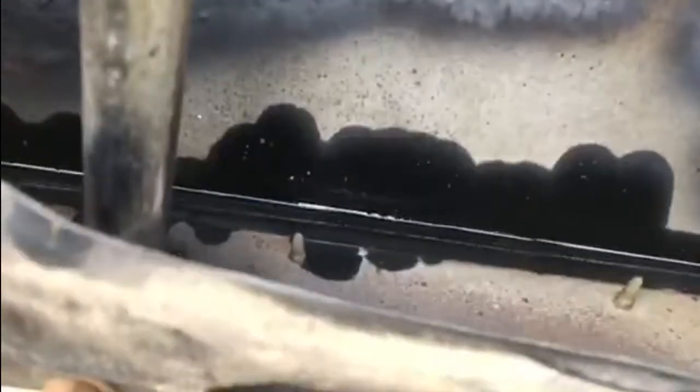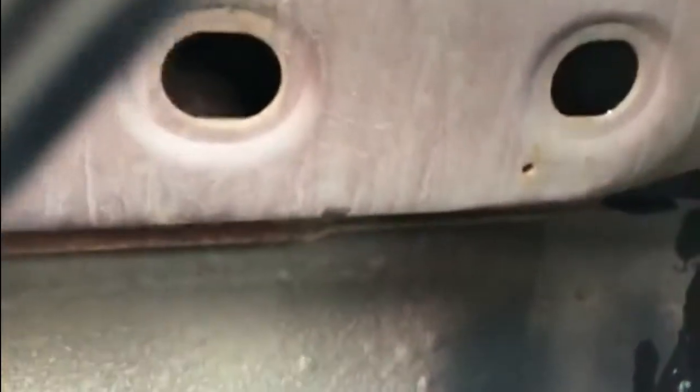The other thing, whilst the door was apart, that I thought would be worth looking at is the bottom of the door. Inside, where that's all wet there, I've just squirted some oil in there — some old oil I had lying around — and as you can see it's all the way through, got it into all the seams. We're going to make sure that none of the seams break open because of any rust in them. It's filled everywhere and up the sides as well. Now, you've got to be careful with this — put some sand down on the ground because you do tend to get a little bit of a leak through the drain holes, especially if you clear your drain holes. Get a bit of sand down there to catch all the oil that's going to leak out, because it is going to leak out.